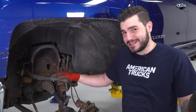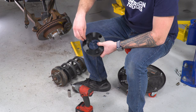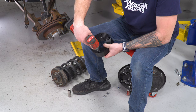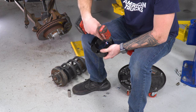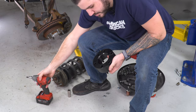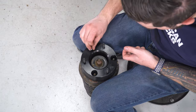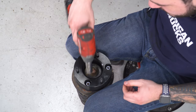You can repeat that exact same process on the other side. First step for the assembly: grab the hex bolts included in the kit, go right through the bottom into the larger holes and start threading them by hand. From there, grab your 8-millimeter hex key or Allen key and tighten it down. Now we can drop it on the top of our strut. Take your strut — I like to put it between my legs just to stabilize it — drop the spacer right on top. It only goes on one way. Once you have it on, drop the nuts included in the kit onto the factory studs, grab your 17-millimeter deep socket, and tighten them down.